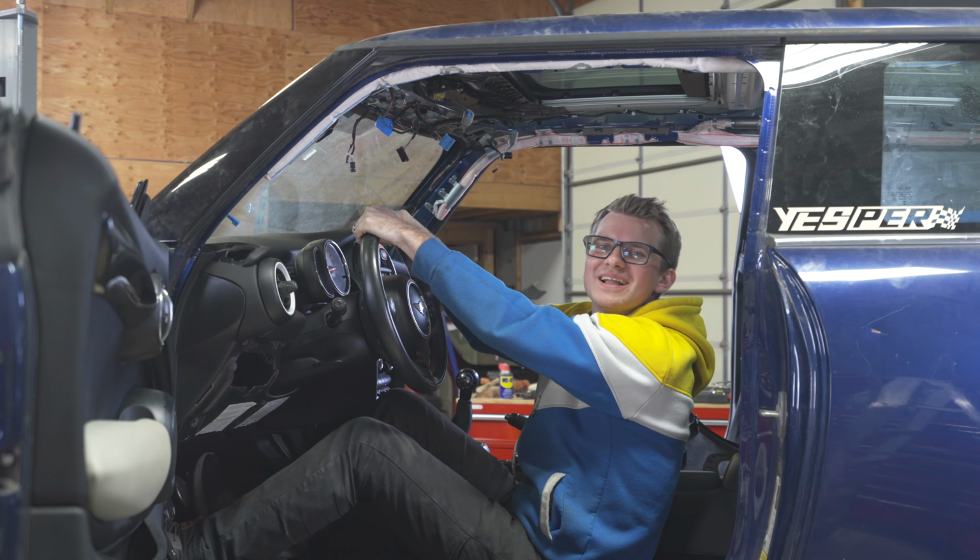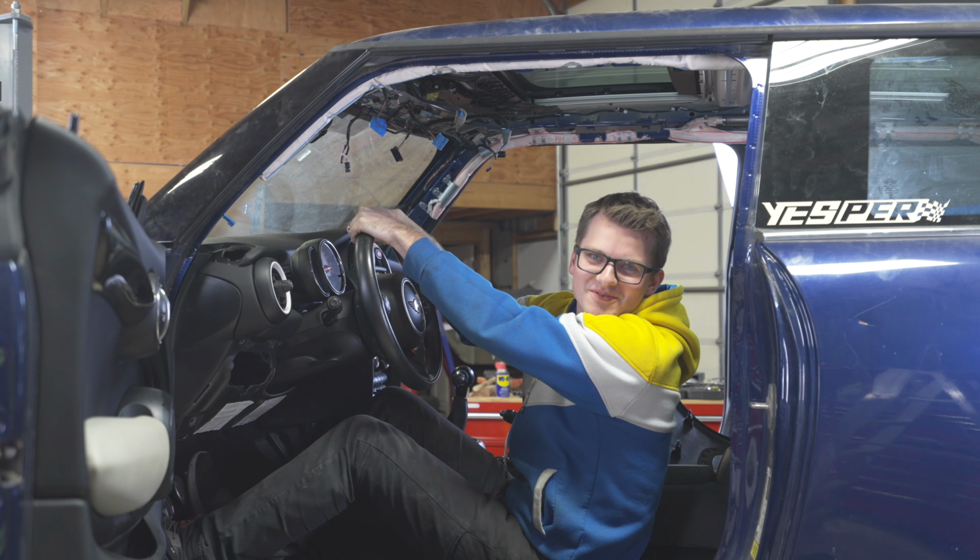And I noticed that when I put my foot on the brake, that little message still pops up saying to press the brake, which I am doing. So that gives me an idea that maybe the pressure sensor for the brake isn't plugged in properly, and maybe that's all we have to do. So Mark plugged the brake sensor in a little bit farther.